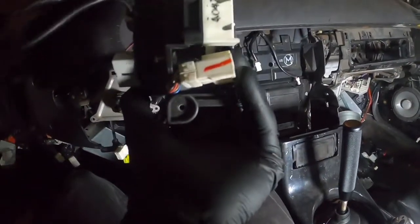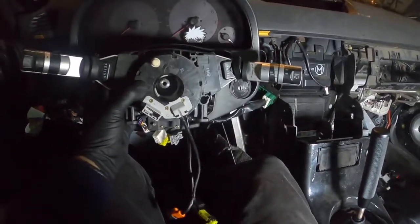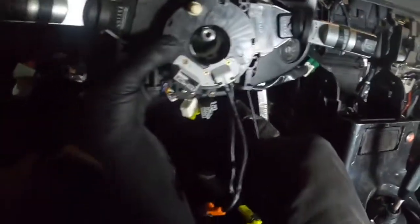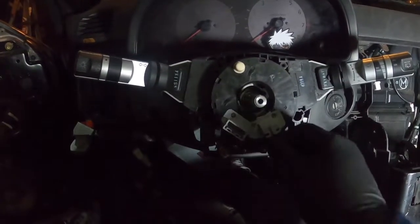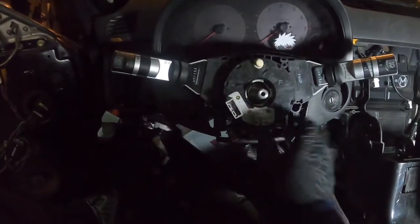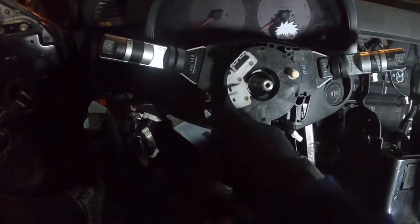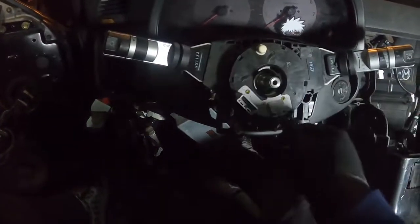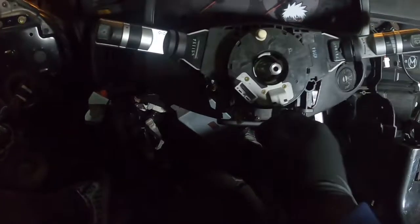So I'm gonna go ahead and move this plate over to the new one. I got that little plate on with the sensor right here, I just gotta screw it down. That's pretty much all you gotta do. Now you throw it back on, remember to connect all your electrical connections, and reverse the process of how you took it out. Alright, I got it installed. I did check the control, it seems to work. Now to show you how you know if it's centered — you go one, two, and once you come around it gets hard. You don't wanna force it cause it'll break. One, two, that's centered. One, two — it gets hard. So that's centered right there.